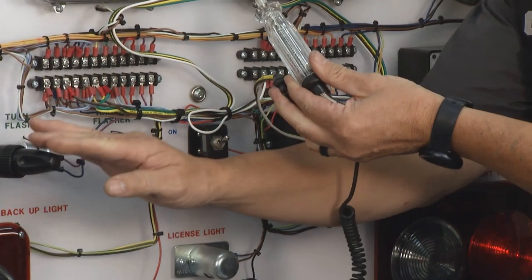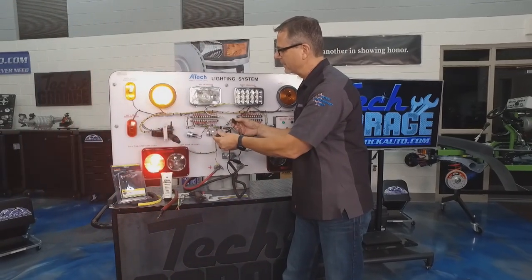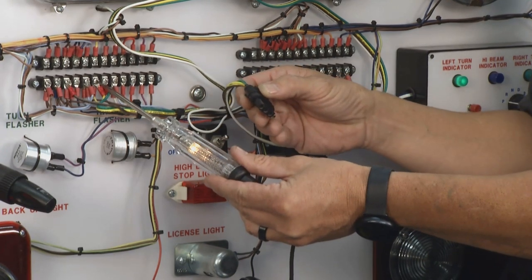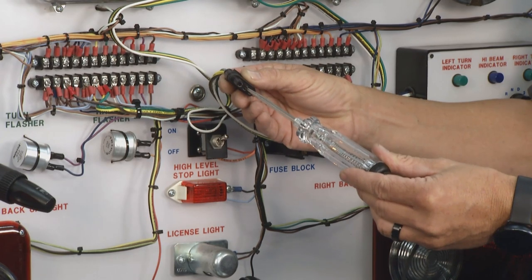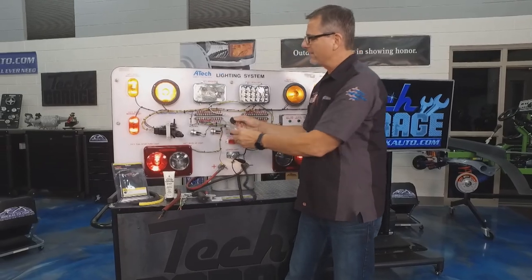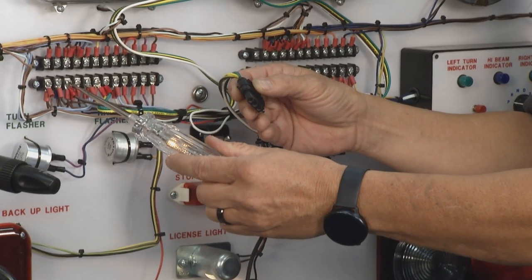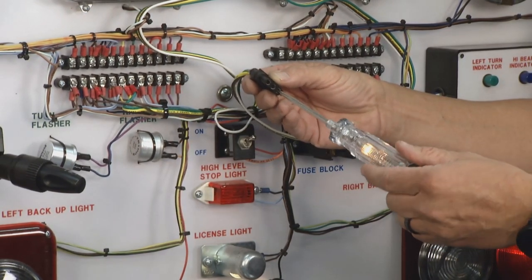So that's our right turn signal — the green wire. Go over to the left turn signal, back to your vehicle — you can actually see it blinking. You found the right wire. Come over here, hit it, make sure it's wired up good — it's flashing. Wonderful. Then you come over here and you have the brown wire. The brown wire is the parking light. Just touch a couple under there — there's the one that's lit with the parking lights. Come over, wire it up, and there you have it.